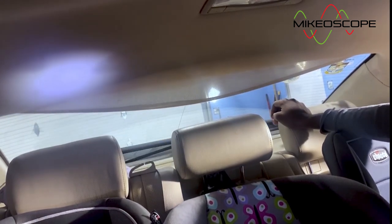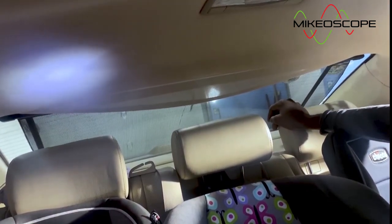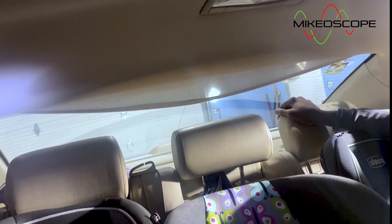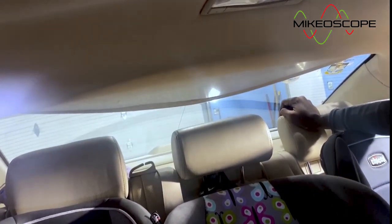So let's try that again. Comes all the way back up. Let's go back down. It's jammed. Check it out, it's jammed right here. All right, okay. Now, as long as I don't let it come all the way up, it works just fine. Okay, so I think we can safely say the assembly is jammed all the way in the back and voltage is getting there, so that's not the problem.